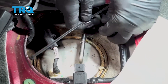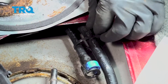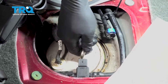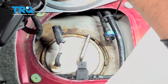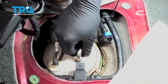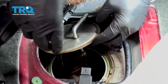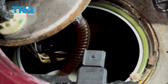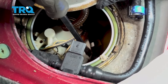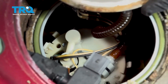I'm going to take that fuel line and just loosely zip tie it to this other vapor line here, just to keep it out of our way — we're not going to snug it down, just want it back while still maintaining flexibility. Go ahead and pop that loose. We want to make sure that this area is clean, so we previously cleaned it with our blow gun to get all the debris off — we don't want junk falling into the tank. Go ahead and pull up on this unit here. You can see down inside the tank there is our fuel pump unit. Inside the tank there are lock tabs — there's one right here, one right here, and one right on the opposite side. I'm going to reach down there, squeeze those tabs inward together, and pull that fuel pump up out of the vehicle.